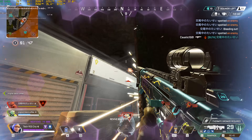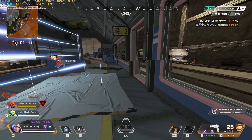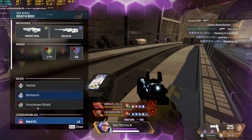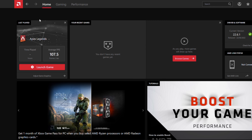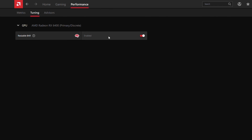With the RX 6400 and i5-12400 playing Apex Legends, we were getting around 147 watts total system power draw out of the box. After undervolting the CPU — dropping it to 3.6 GHz from 4 GHz all-core and applying minus 50 millivolts — we dropped down to 137 watts. What surprised me about the RX 6400 is that it's completely locked out; I couldn't undervolt the card at all. The options just aren't there in Adrenaline software or MSI Afterburner.